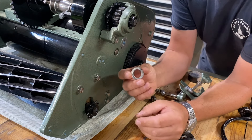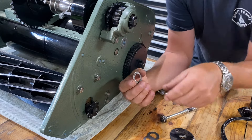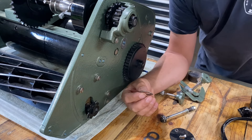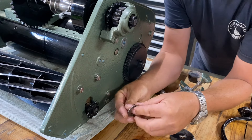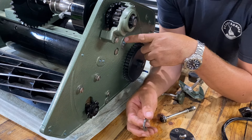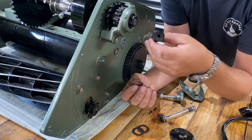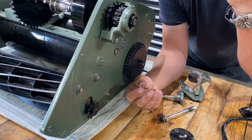Due to the clutch having load on it while driving — as it'll be pulled in with this big bolt — it will now require a thrust bearing, located here. That wasn't necessary before with how it was set up, but it's definitely going to be necessary now. Ideally I want to use washers on either side of the bearing. The surfaces here are relatively flat and smooth, but for the time being I'm going to run it without those washers because there's just not enough room with the length of the bolt.